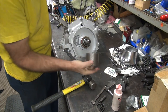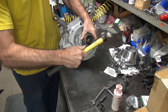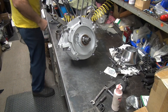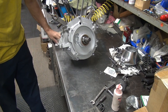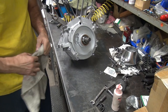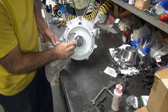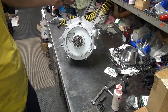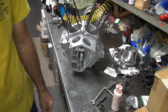Use the big hammer — just going to tack it in there. Here it's all the way in. You let the weight of the hammer do the work, not you beating on it. Missed a couple spots — this goes in all the way now. Wipe off the excess. There you go — main seal is in. It will keep 99% of the crap out of the motor. That's basically how I consider a lower end being done right now. From here on you start putting the cam chest together, which is this side. We'll be back in a minute.